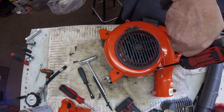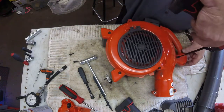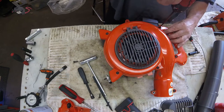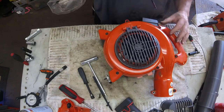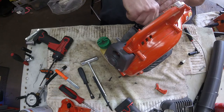You see I've got a compression gauge sitting on the bench — that's certainly another option. But once you have it torn down as far as you did, just pull the muffler off and take a look at the piston and see what it looks like. The visual signs of scoring are more important than any compression numbers you might see.